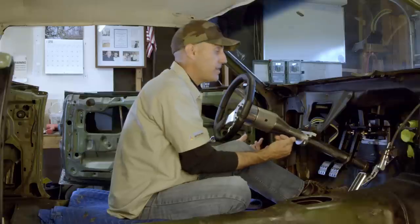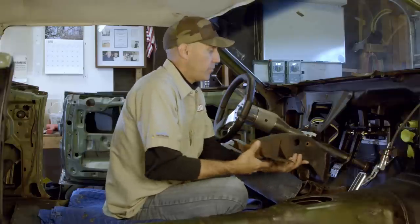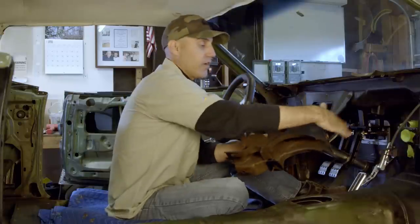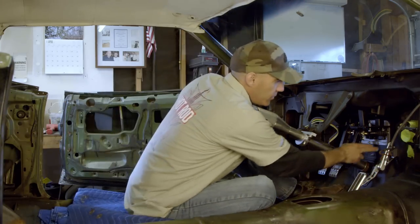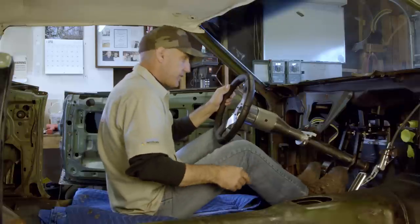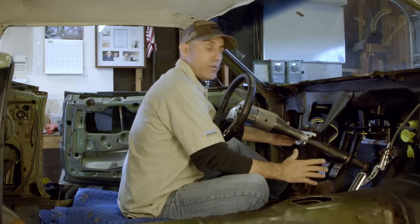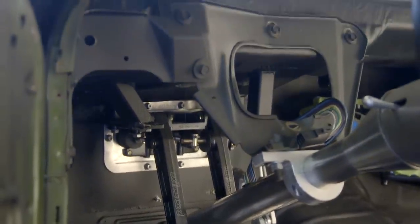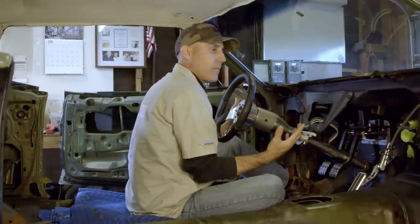The other thing you'll have to deal with on these cars is this giant chunk of steel that used to mount the brake pedal and master cylinder to the firewall. You're removing that to make room for all this. But you can't just have the sheet metal plate on the wall support everything — this is going to take a lot of abuse over the years from hard stops and vigorous use. You have to figure out a way to support it. On a race car you'd tie into a roll cage, but this car probably isn't getting a full cage.